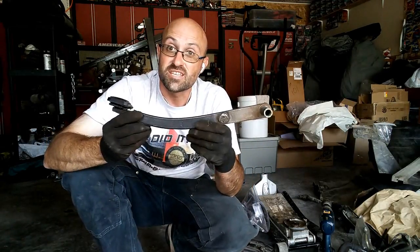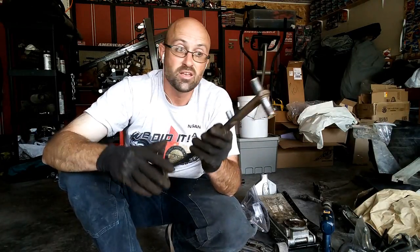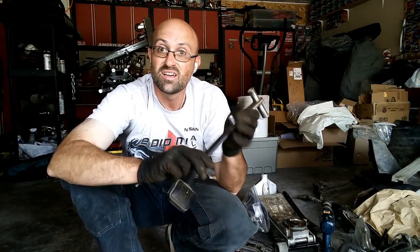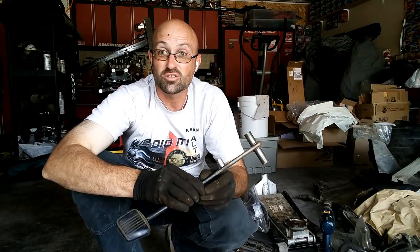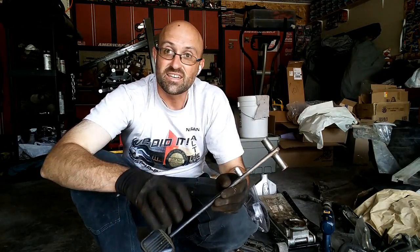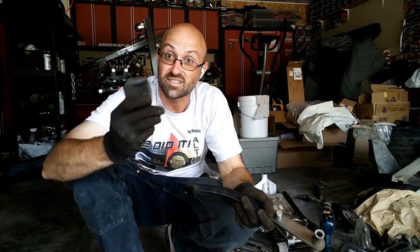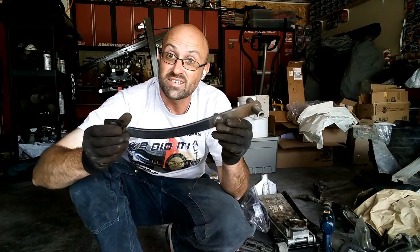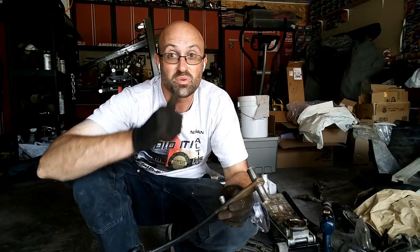You're also going to do the same thing down on your pedals. So this is the brake pedal — you can see that most of this is black down this way. I'm just going to use some light sanding, maybe 400 grit, to get this cleaned up. I'm going to hit it with some rust reformer after I take off the pedal pad, just like that. Take it off, sand it all down, prep it, paint it. That way everything will be covered, have no corrosion, and it will be a nice black when it goes in the car.